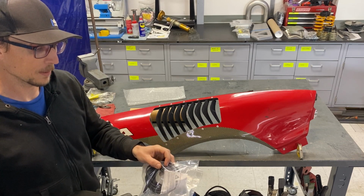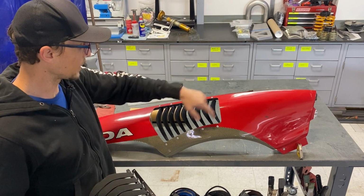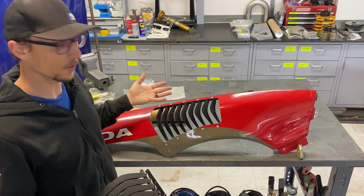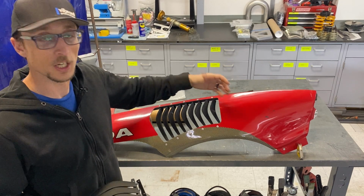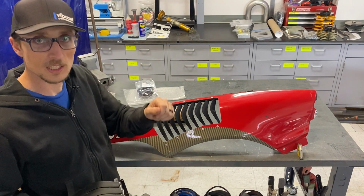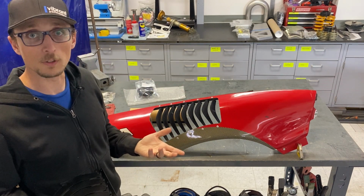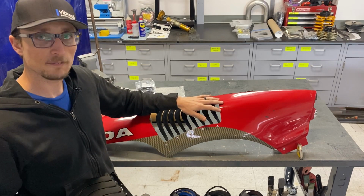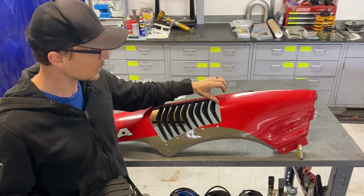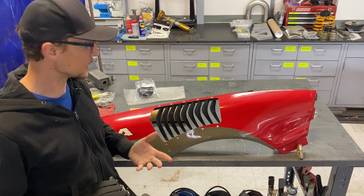It also comes with rubber trim, which you can use. I like to cut my holes for the louvers, and then the next step is, of course, you wrap the livery onto the car with vinyl, and so I just wrap all the way up to the edge, so you get a nice clean edge. But the rubber trim is your alternative. If you have some little mistakes, some of the edges are rough, you didn't get a perfect radius somewhere, or if you're not going to repaint it or wrap it with vinyl afterwards, you can just use that edge trim, and the trim just goes over the lip where you've cut, and you can run it all the way around the perimeter of the hole, and it gives it a nice finished appearance.